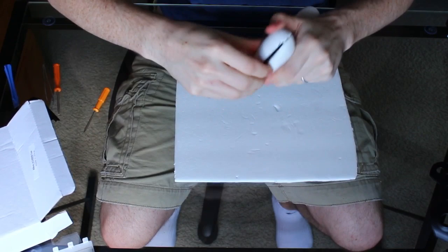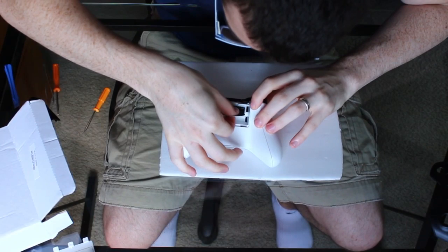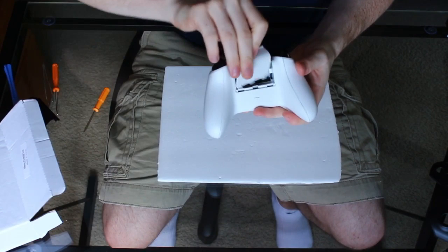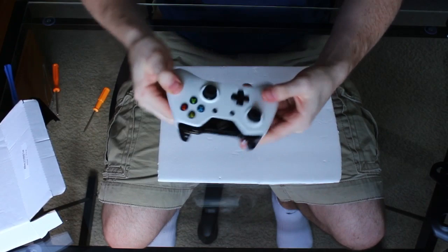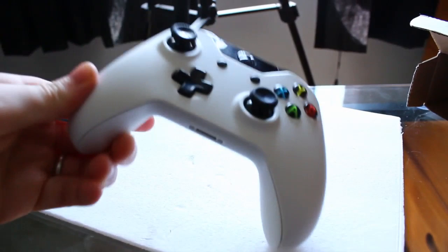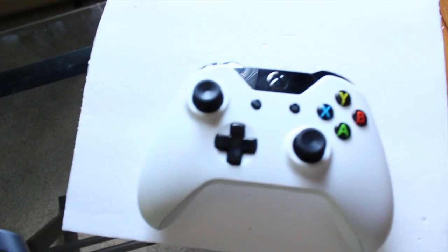They're a lot easier to put on than they are to take off. Once you do that, look around, make sure everything's right, and you will have your new Xbox One controller. They have those special glossy white ones you can get on eBay for like $400, or you can just buy a $15 shell like this and do it yourself — and it looks just as nice. It's not glossy, but I like the matte; doesn't look bad. Put the sticker back on, put the battery pack cover on, and there you go — you have your custom white Xbox One controller. Looks great, you don't have to pay all that money. Close-up shots here — doesn't look cheap, doesn't look like a knockoff. It's probably what they would use — some manufacturer from China. Looks really nice. If you like this video, hit subscribe. Thanks.